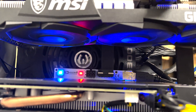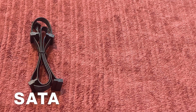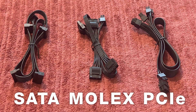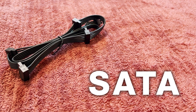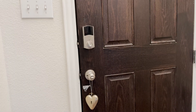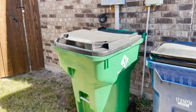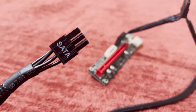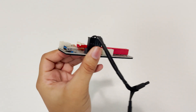The three connectors you'll most likely encounter when building a rig are as follows. The first is SATA — everyone's favorite fire starter. Next is Molex, the elder of the bunch, and the previously mentioned PCIe, the best of the best. Do not use SATA to power your risers. I repeat, do not, under any circumstance, use SATA.